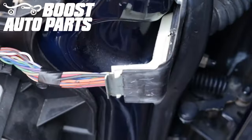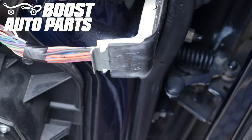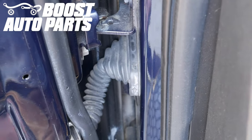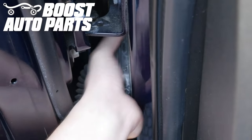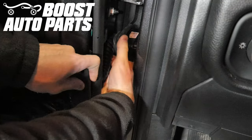There's a plastic piece attached to the metal boot — take a trim tool and remove this plastic piece as shown. Remove the boot to the cab by squeezing the two tabs on the top, one on each side — it'll pop right off. Then fully remove this connector and harness from the slot in the door. You may have to close the door slightly to get it completely free.